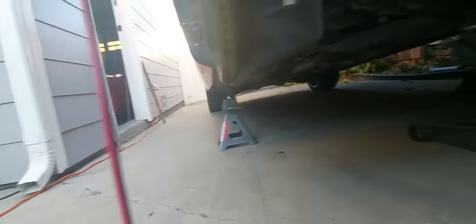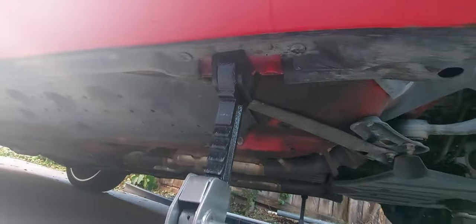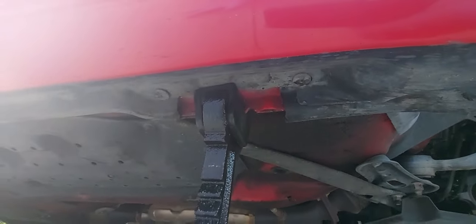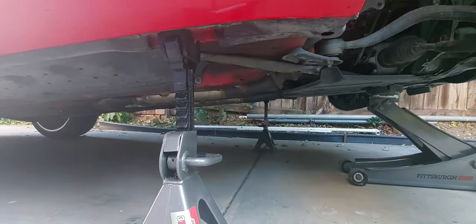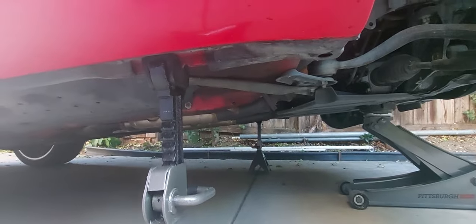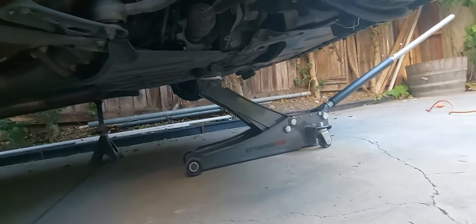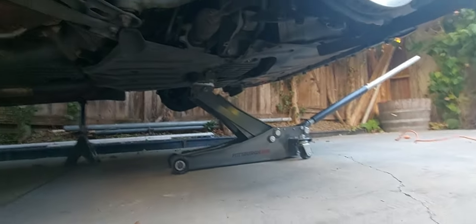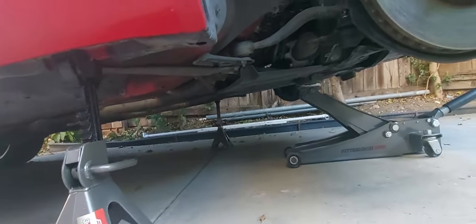As you can see, I have two jack stands — three ton each. The proper way to do it is: first lift the car completely, then put a jack stand on each side, adjust them properly, and place them in the right jack stand points — one on this side, one on the other side. Align them and make sure they're sitting correctly in the right place. Then slowly bring your jack down and let the car sit on the stands. I leave the jack there as well just for safety. This is the proper way to lift up the car.